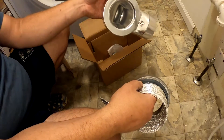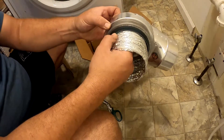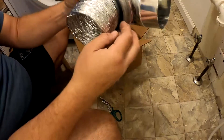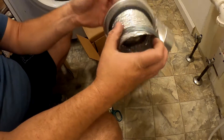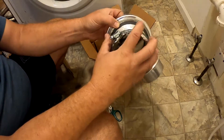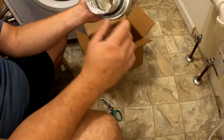So we're going to try mounting this today. Our first step will be determining exactly where this needs to go, marking our wall, pulling our dryer slightly away, and then we will screw that bracket on. As you can see, get it anywhere close and it sucks on — there's no dryer in the world that blows hard enough to rattle that loose. That's a nice strong bond. I think this clamp is included and is fused permanently on here, so that clamp is for you to screw it onto your dryer, giving a nice secure connection. The nice part is I can pull the dryer far enough away from the wall to really take the time to get this on there the right way, and maybe even sink a sheet metal screw through the clamp into the dryer flange — then I don't have to be back behind there trying to make that connection. As soon as we back the dryer up next to this and we're close — boom — clips right on.